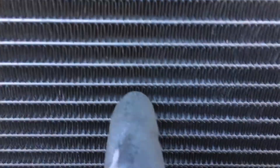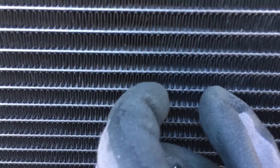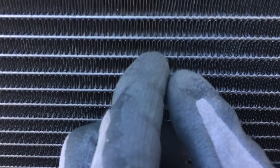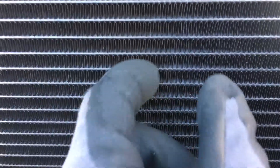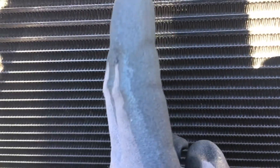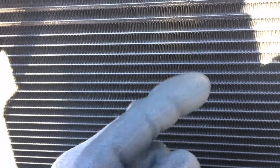If you actually get a ruler and measure the fins per inch — on the OEM condenser I had on here, the OEM was 19 or 20 fins per inch. On this aftermarket one, I put my ruler up here and go one inch out, and this one is only 16 fins per inch. So we're two to four fins less per inch. Now multiply that across the full width and by 40 rows — every fin is a surface area, and that surface area is rejecting heat. They cheated you. They gave you a lower price and you said 'oh great, I got a lower price condenser' — but they shorted you on fins.